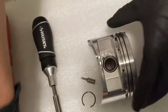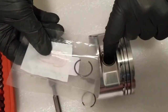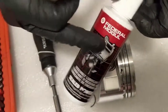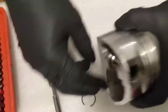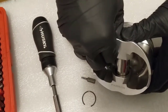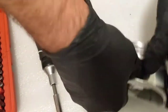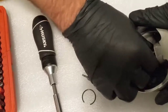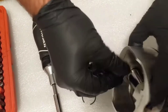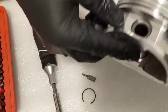And that's it. Later when I get all my pistons, I'm going to put assembly lube in here before putting that back in. But basically that's it. Now I'm going to put my finger here and push it tight. This was black, full of carbon deposits — but if you're following my videos, you can see this is clean already. We already did that job.